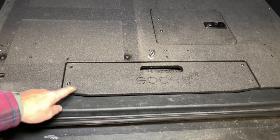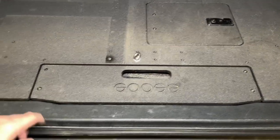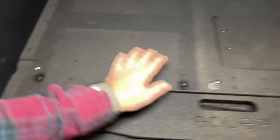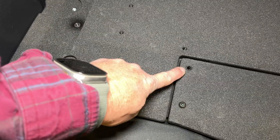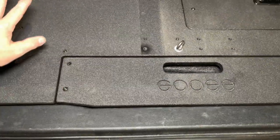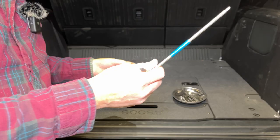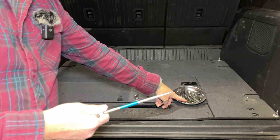Now, this is really important to note. There are four screws into this and this thing just slides out, but the way to slide it out is to undo all these screws. If you're going to mount a fridge on the driver's side or the passenger side, depending on where you get the rear hatch access, it's important that you remove the screw that's going to be covered up. You can see here that my fridge covers up this section, and I have a little bit of room to get these bolts out. I'll show you later, once I install the fridge, how we bolt this floor down and pull that thing out. So again, 5mm Allen included hardware with a washer — really important that you use the washers, and they provide all that hardware for you.